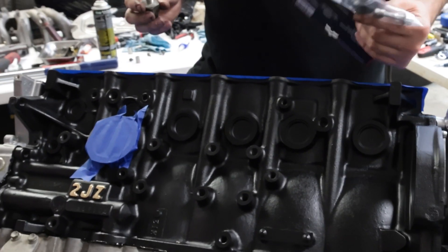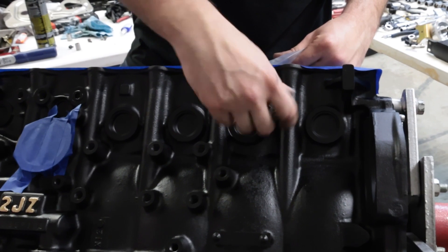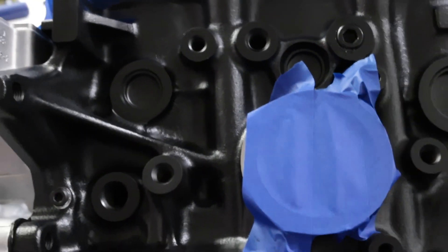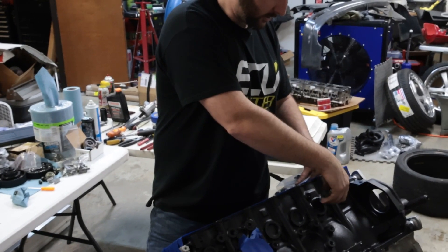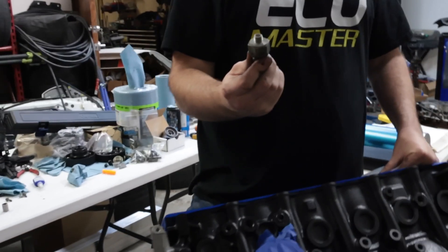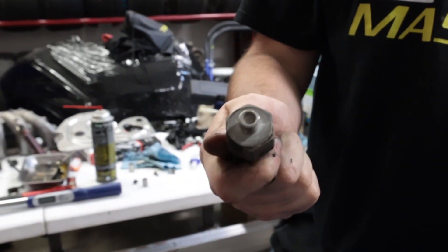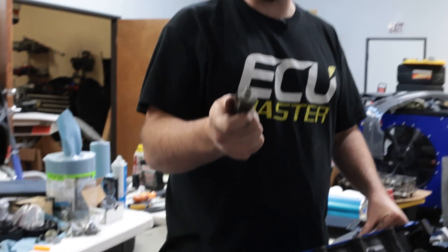One of those things that's way easier to do out of the car is to upgrade knock sensors. This is a factory knock sensor — there are two factory knock sensor locations on all Toyota inline sixes I've ever seen. Actually the early 7Ms only had one, but all the JZ motors had two. It's a one-wire knock sensor. These are called a resonant style knock sensor, meaning they ring at one frequency, so not terribly useful. The good news for the designers back in the day is that the ECU didn't have to do a lot of processing — you kind of look for voltage on the sensor; if there's voltage, it's ringing, if not, don't worry about it.